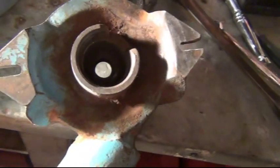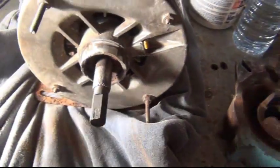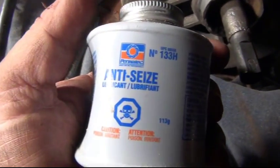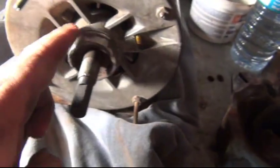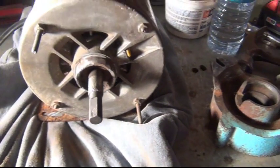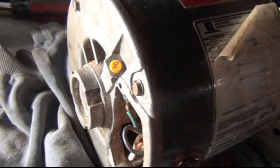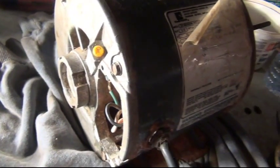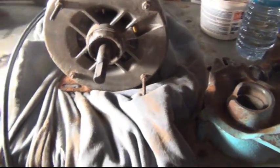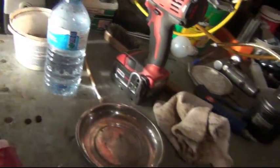I would look for another pump — it's kind of old and it's just going to rust again and have the same blade-hitting problem later on. I'm going to put some anti-seize on this side all around here because I had a hard time taking it off, so if I have to take it again it won't be a big deal. I also put some oil in here — take the little cap off and put a few drops in. There's just a little sponge in there that holds it to keep the shaft lubricated.